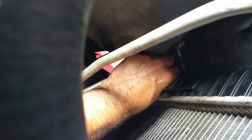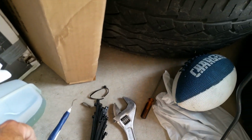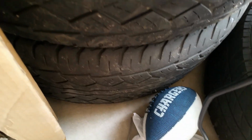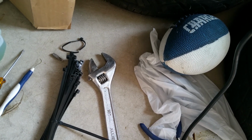God, that radiator fluid inside that upper radiator hose is hot on my arm. Not sure what the right way to do this is. Just shimmy it back evenly, I would imagine, so you don't crack it. But this thing's 10 years old, so you can see on my fingers that that one bottom one's leaking pretty good. I bought a set of picks at Harbor Freight, but I left them at my friend's house, so I'm just using this dental pick to get underneath the quick connect spring doodad, and then I'm holding it with one hand while I pry it up with this one so I don't lose it. I'll show you that in a second.